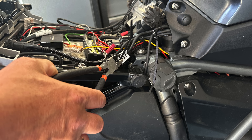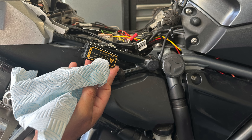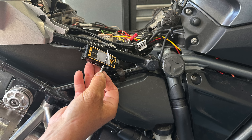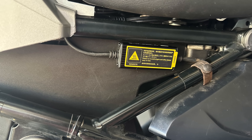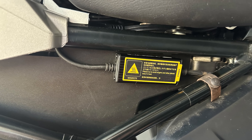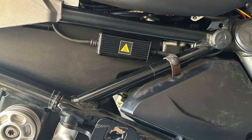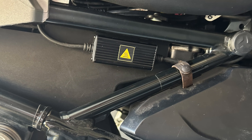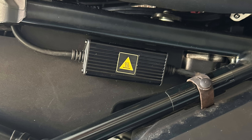Pop the screw back in. A zip tie makes feeding the connectors much easier — feed them through with a bit of a wiggle if needed. Once through, attach to the battery terminals and secure everything neat and tidy. Covers go back on and use zip ties to keep all cables tidy. Clean the area where the power module will go with rubbing alcohol and secure the power module with the other 3M pad. Make sure to stick the 3M tape onto the non-sticker side of the power module.